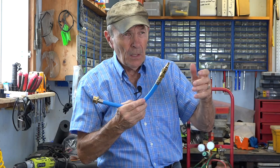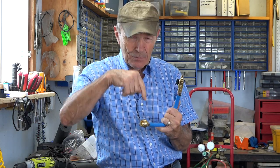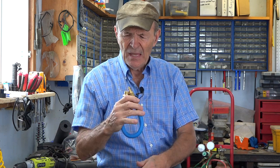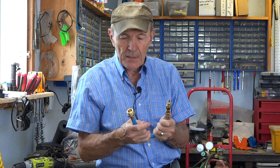We also have a travel trailer, and the travel trailer has water through all the lines — you need to get all that water out as much as you can. We blow the water out and then use antifreeze, because if you just blow it out, you can still get frozen lines. Even if you blow the water out, there's still a thin film of water on the lines that runs down to the lowest point and freezes.